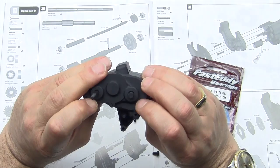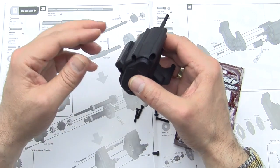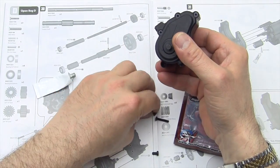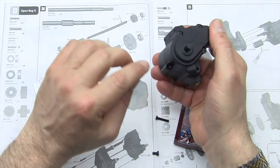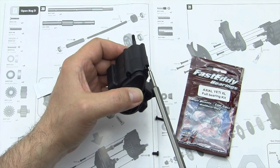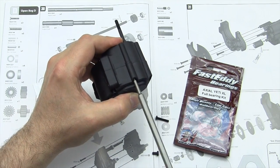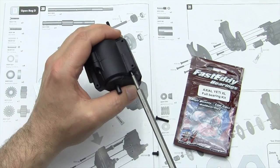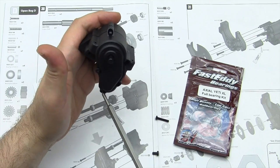And at this point, we are going to put the screws in. And there are a total of 1, 2, 3, 4, 5 screws. So we'll drop those down in. I'm going to save that one because it's going to fall out until we get it tightened up. Get these screwed in. I have this clutch on this set very, very lightly. You don't want it set too tight or it'll strip the screws out. Okay, so I think we got them all.